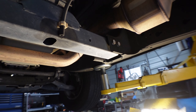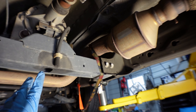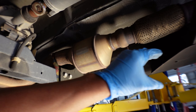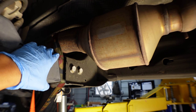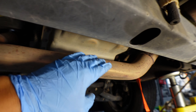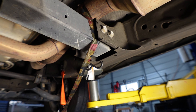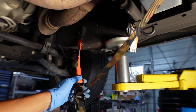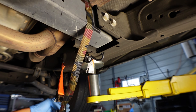I'm going to use a ratchet strap to get the exhaust down. I'll do mine a little differently from others — some people put a 2x4 and strap it with the muffler to bring it down. The purpose is to get a little more gap from the pan. I've got a ratcheting strap set up, hooked it on the side and looped it around on top of the muffler.